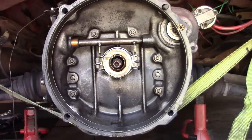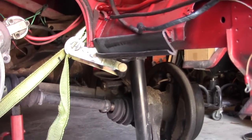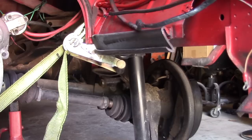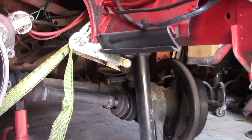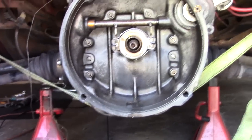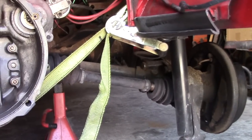As far as raising the bus up in the back, all that requires is you have to disassemble all the suspension components and redegree the spring plates. That's the rear torsion. And we probably won't do that right now. We'll probably do that at a later date. And I got to figure out what's going on with the spindles in the front. If I can raise it back up in the front, that's something I want to do while I have everything apart, and then I can come back here and just do the torsion adjustment. So that's where we're at.